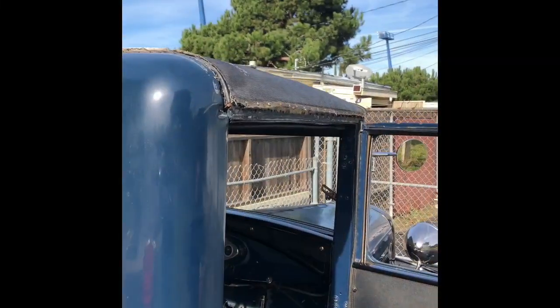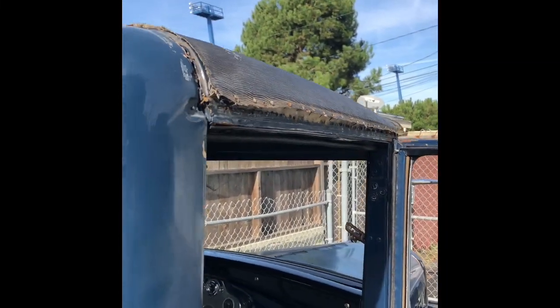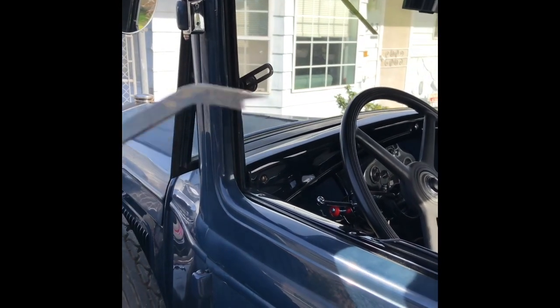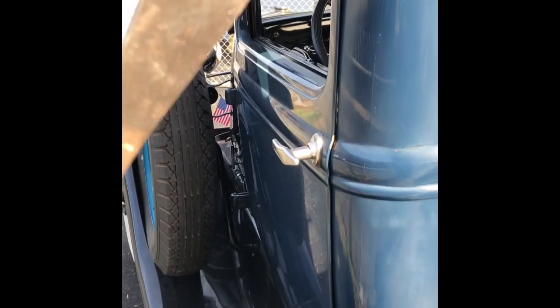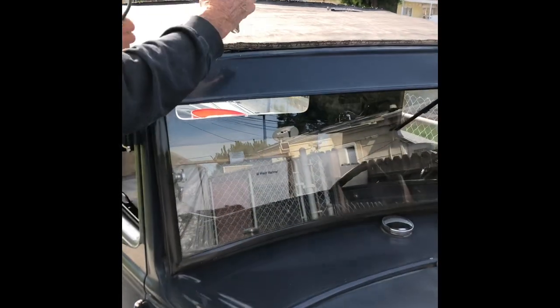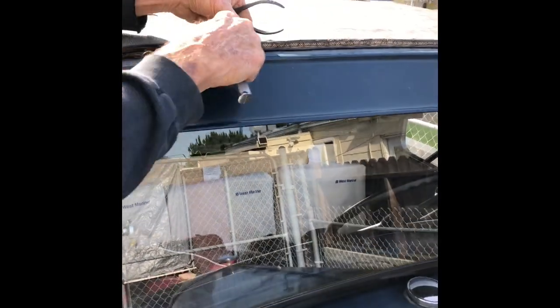This is to start pulling off the old one. We pulled off the rain gutter. You can see that the tacks are still there, and they're just pulling off the top. The tools we're using for this are this little tool, which is good for pulling out the tacks or the nails, and this little bar, which was used to pry off the rain gutter without bending it. You got a little bead on top. You have to fold it back and then take a dikes and then some kind of puller to get those tacks out.